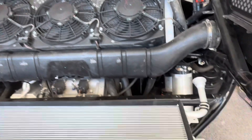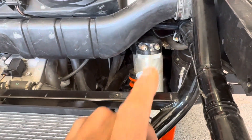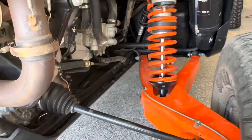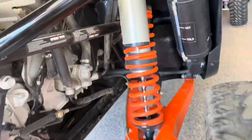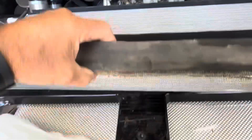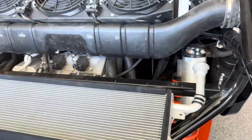When I talked to Robbie, we had a conversation about this — I had water leaking and I didn't understand there is no catch can on this. So if you're pouring clear liquid in up top and you're getting liquid out down here that has coolant in it, you have a leak in the system. That's what was happening to me — you can see a little bit leaking here and on top of the motor. Just be aware: if you put water in and it leaks out somewhere else, it's not coming out of the overflow — you've got a hole in the radiator or a hole in the line.